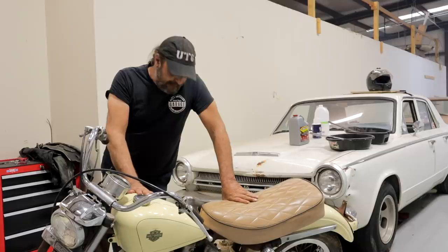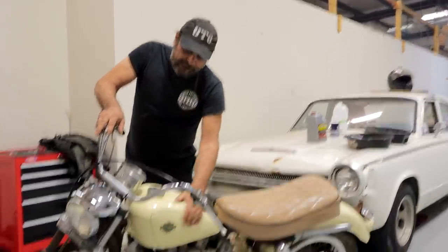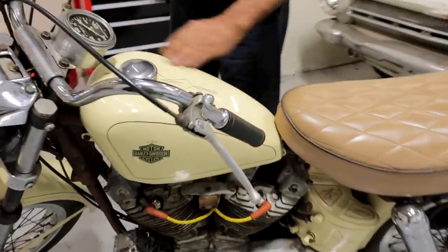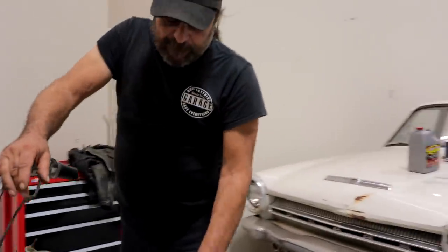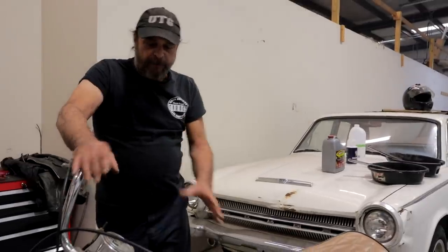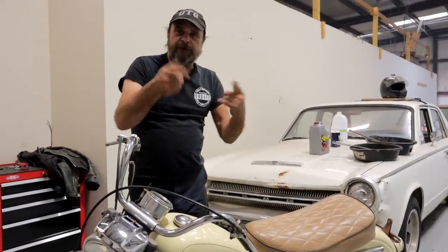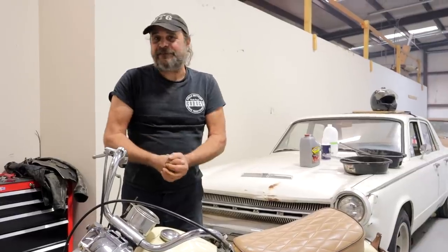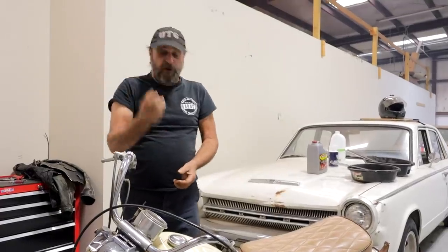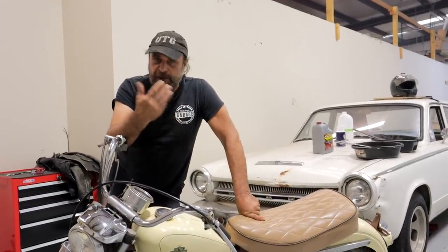What happened with this tank is it has this old paint — must be 40 years old — with pin striping on it, and I'm very afraid of damaging the paint. I'm trying to preserve this thing. So I tried to pull the petcock out without taking the tank off the bike. The petcock would not budge. I tried everything I could think of and got to the point I was afraid of either breaking it off or tearing out the bottom of the tank, so I just left it. And miraculously, the petcock itself isn't clogged. I don't know how, but it flows freely.